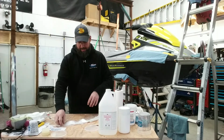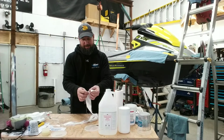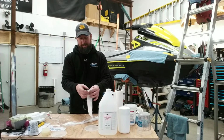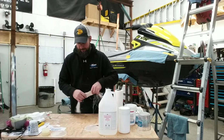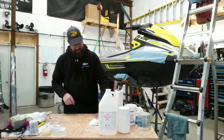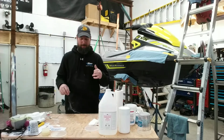And if you can have your ends feathered, I'm not sure how good that's going to show up here on the camera, but if you can have the ends feathered instead of squared off like that, that's better. I'm not going to worry too much about it on this piece, because this outside edge is probably going to get sanded off prior to laying up some more fiberglass and some more filler. So that being said, I didn't put my epoxy on warm water to get it liquidy and warmed up yet. So I'm going to go do that, and then I'm going to come back, and when I see you next, we're going to be mixing that up and getting our consistency right so that we can go lay this up.